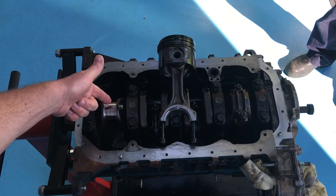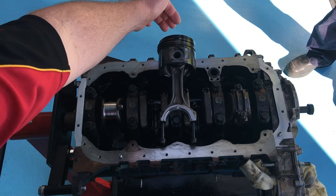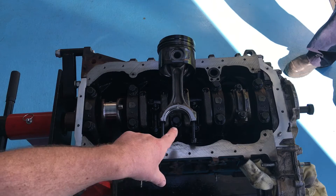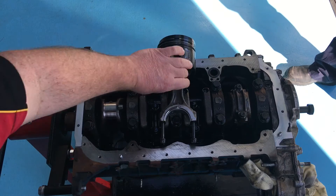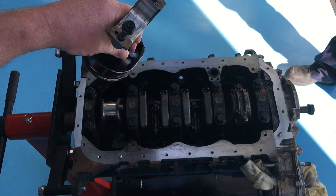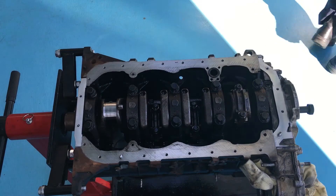This part here is your crankshaft. It goes all the way through here through these bearings — that's the bearing where it's fixed to the block. These are your conrods. All the pressure of that explosion we demonstrated hits, pushes that piston down, and has to go through all these connection points as well. For a four-cylinder engine, these are quite decent-sized big-end bearings. Usually they last ages with no issues whatsoever, unless there's oil starvation problems like blocked oil pickups. This one is in pretty good condition — really awesome condition, to be honest. Let's turn the engine over so everybody can see how the conrods, pistons, and everything works together.